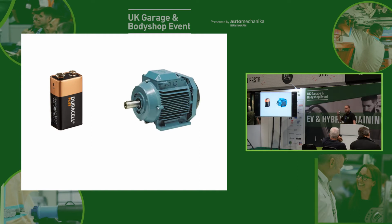Obviously, if we're going to power our vehicle with electricity, the two things we need are a battery and a motor. And between the two, we're going to need some sort of control so the motor doesn't run flat out all the time. So if it's a DC motor, we're going to have a controller, and if it's an AC motor, we're going to have an inverter. So the inverter is going to provide the AC motor with a moving AC waveform. The rotor then follows that, and that's what drives the car up the road. And virtually all modern mass-produced electric vehicles will use the AC motor.